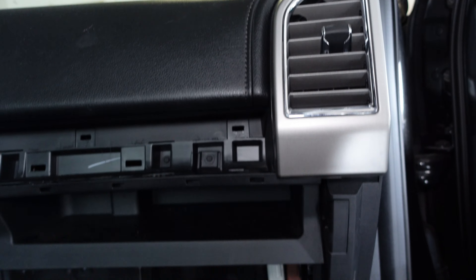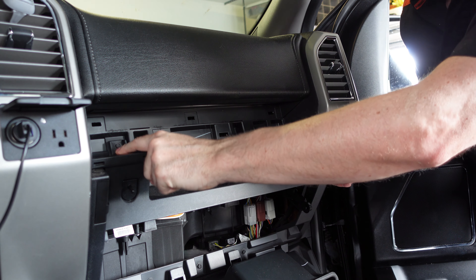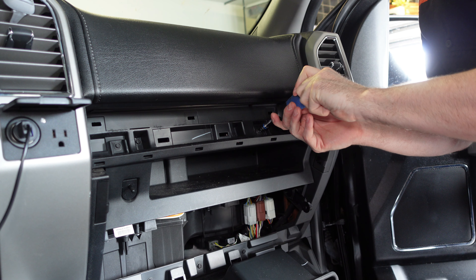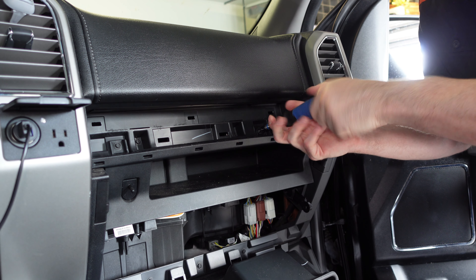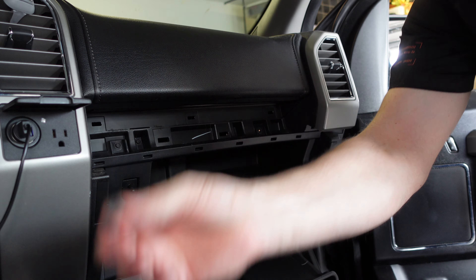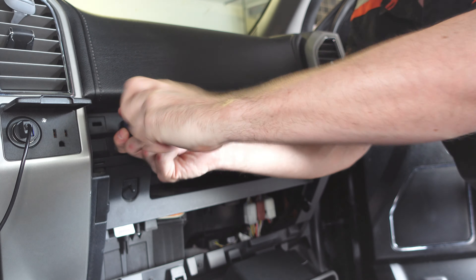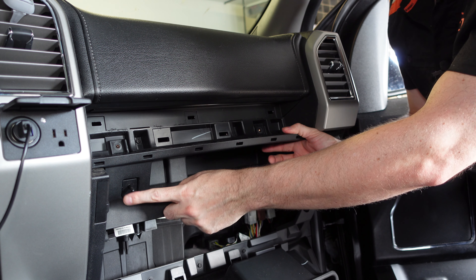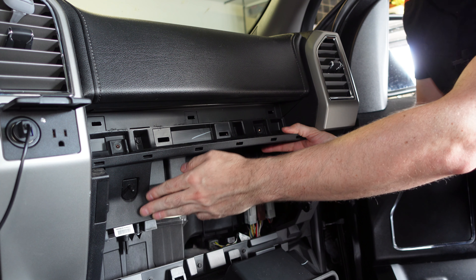Move that out of the way. Now you've got the final trim piece here, and there are two screws or bolts that you need to remove — that's where you use your seven millimeter socket. You can visibly see four but you only need to do the two that are more outside. Don't lose these — put them in a safe place, the cup holder makes a good spot. Then finally this whole piece will pull out — it is popped in place so be careful. Also, you have an electrical wire that works the switch for the light in the glove compartment, so be mindful of that wire and don't pull too hard.